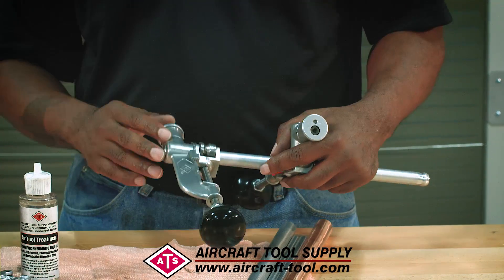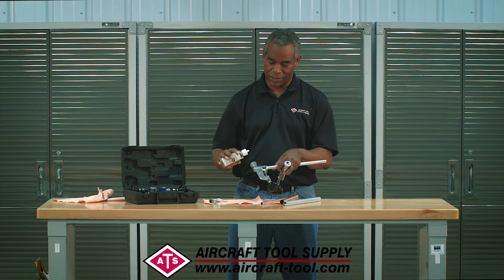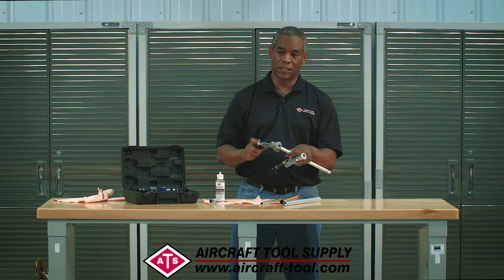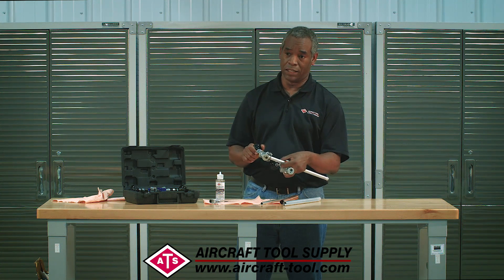How do you know when to stop? I get that question quite a bit. At some point it's going to get draggy and oil is not going to make a difference — that's when you know you've hit the end of the road. Like right here, I just added oil and I don't feel any difference. I'm done. The bead is done. I can also visually look at it and tell that the bead is complete.